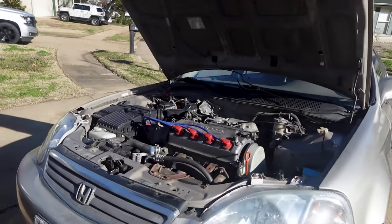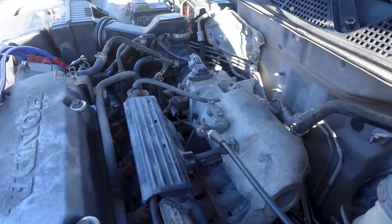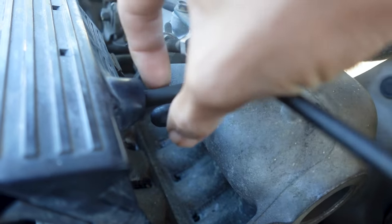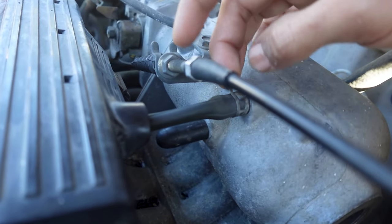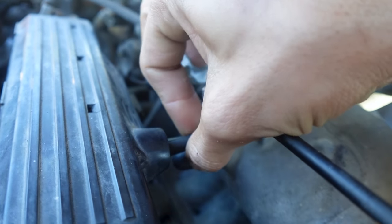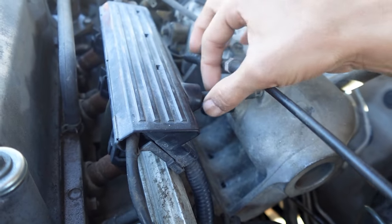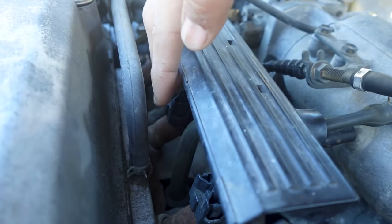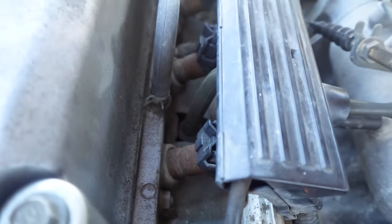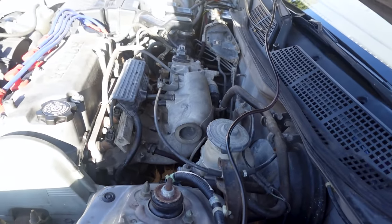What I've been wanting to work on is the PCV system. Check this out — see this hose and how it looks like you've been trying to suck a milkshake through a straw. I'm definitely going to be changing out this hose. More than likely the PCV valve is clogged up and that's why it's like this. The PCV valve is just down here on the intake if you follow that hose, but you have to get it from the bottom side.